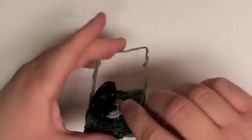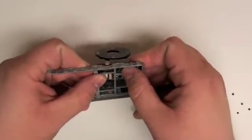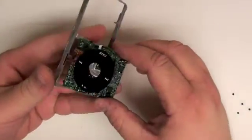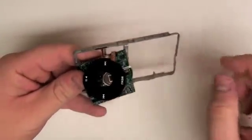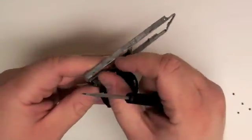To remove the track pad and logic board, push the logic board out of the middle frame. This is only held on by adhesive. There will be a piece of the ribbon cable attached to the middle frame, which is also only held on by adhesive, so gently pry this off with your finger or your flat tool.